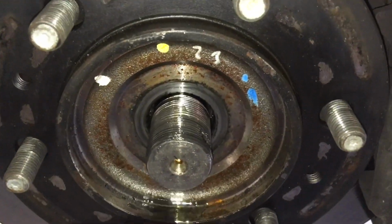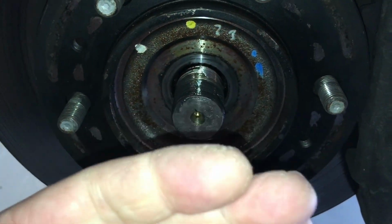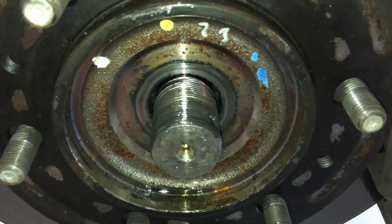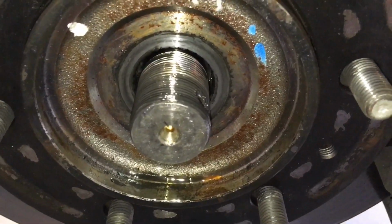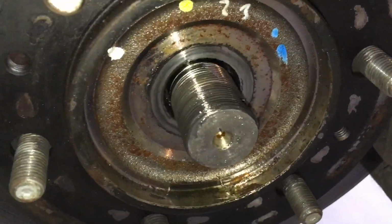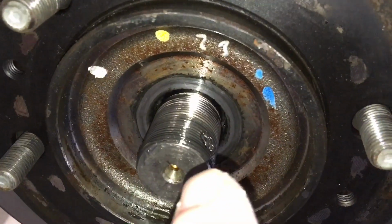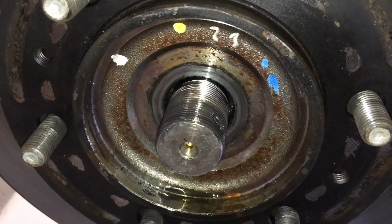But the point is, you put the nut on and you can give it a gentle tap, tap, tap on the end of the nut, because that's covering at least six turns of the thread. Still, if you smash it, you could still damage the thread, but generally you can tap that firmer than you're going to be able to tap the end of this, if you know what I mean. So it can be a good idea to leave the nut on there. Not in this case though, because the thread's already wrecked. I suppose it wouldn't really matter, it's going to come off anyway, so we'll see what happens.